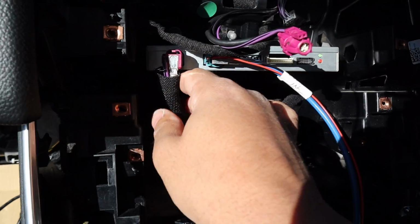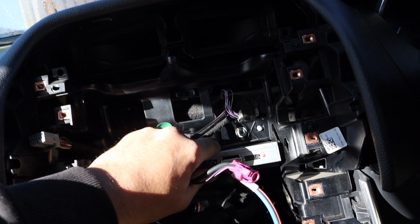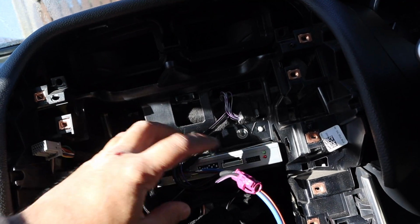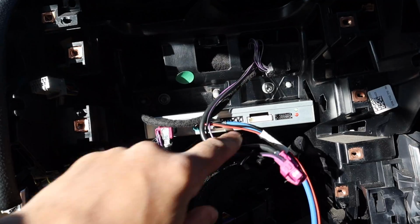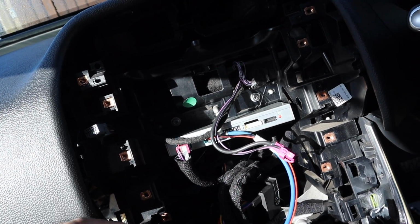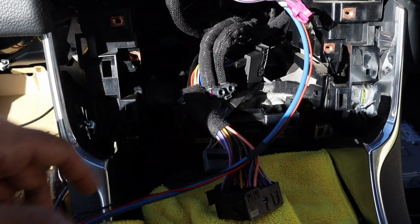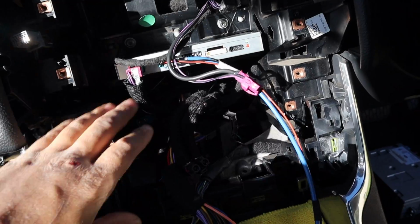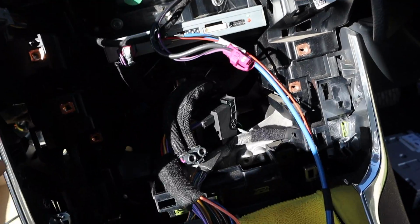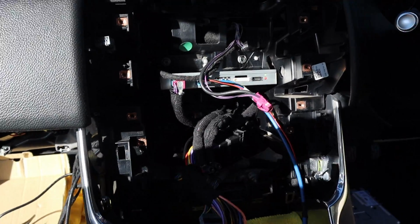Very short cable here, so it's 10 times easier for everyone if we just mount the module right there, double side it down, zip tie it down so it doesn't go anywhere, very accessible. We have our dip switch settings here if we need to access them, and that's it. So essentially we can get this neatened up, plug our power in, plug our LVDS in, mount this, just get it sitting in place with a couple of screws so we can start doing some basic testing at least.